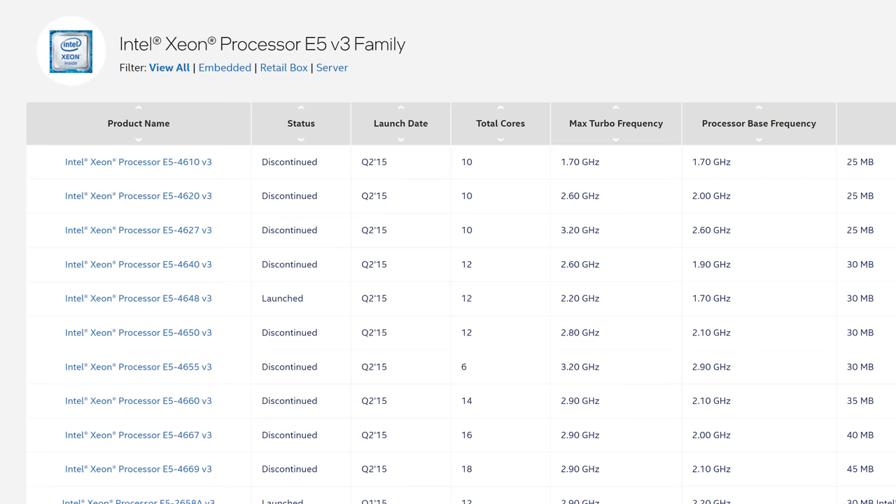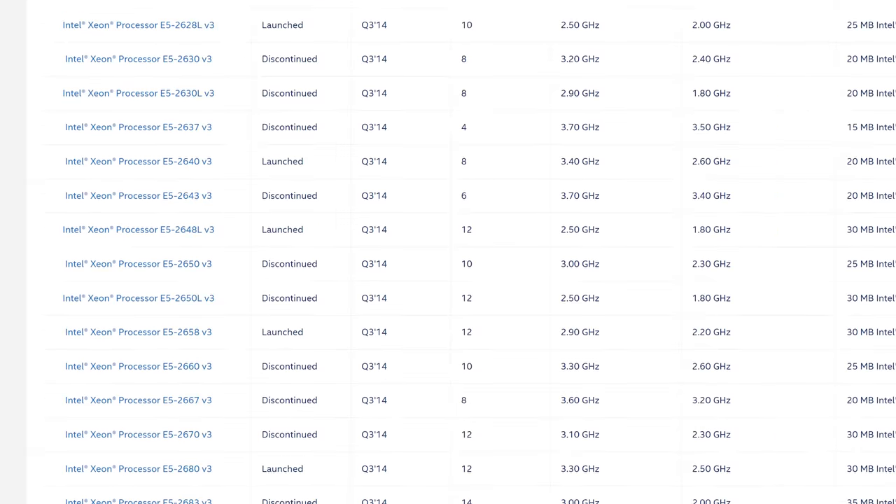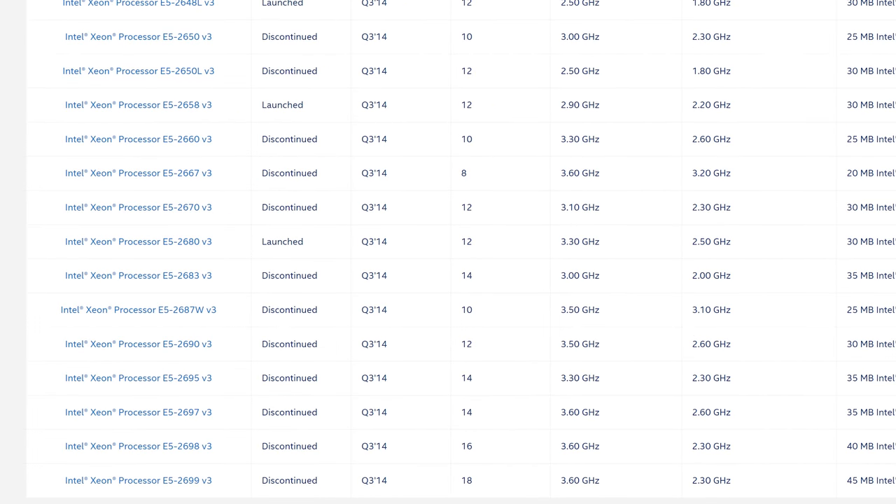For those of you who want to go the x86 route, keep in mind your use cases when choosing the parts. For the most part, any Intel or AMD CPU can be used at the heart of your system. The first things to make note of are the thread count, clock speed, and age of the platform. The more cores or threads you have, the better your CPU will be at running multiple services at a time. For someone just getting into home labs, four cores and eight threads is a good starting point, but you can certainly go for more or less.